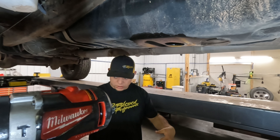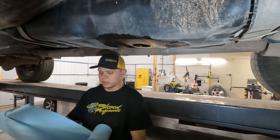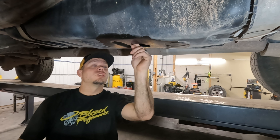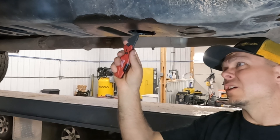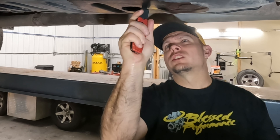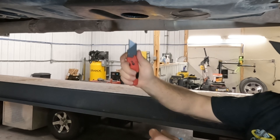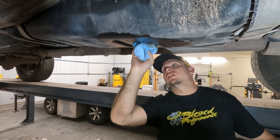We like to just let it drain until it's done. This one had 30 gallons of diesel in it — this was kind of a 'let's get it done before we head off to a truck show.' Once you're done drilling and cutting into the tank, what we like to do is go in with a paper towel and try to clean up any of the loose debris. You can also take a knife and go around and knock any of the leftover plastic off there. You're not looking to make it perfectly smooth — it's a drill bit, so it's never going to be perfectly smooth in there. All I'm doing is trying to clean it up without losing the roundness of the circle, so I don't get any plastic in the fuel system.